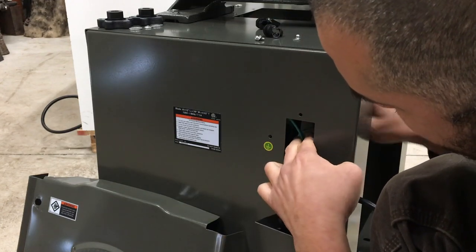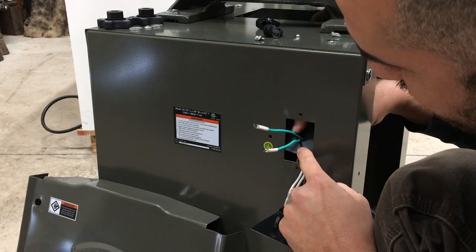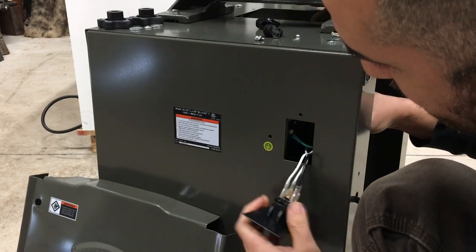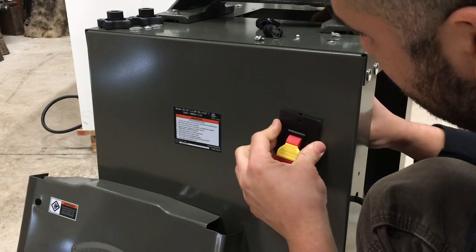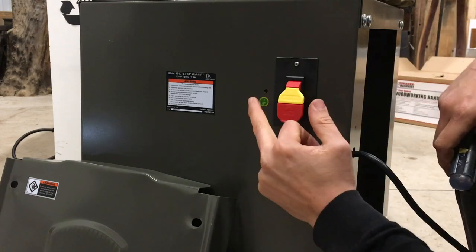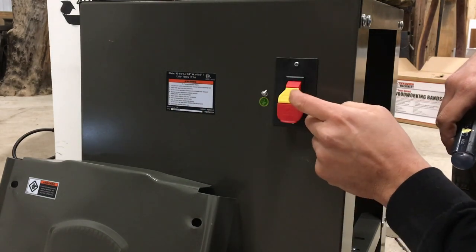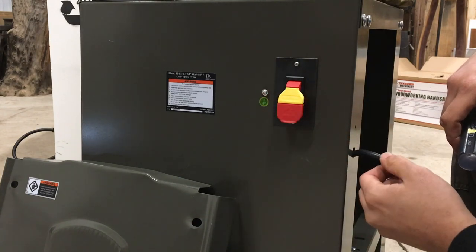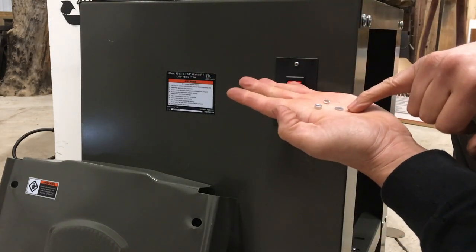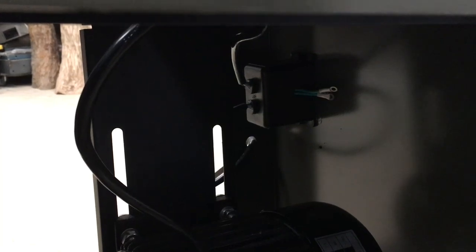Be sure that the two green wires from both the power cable and the motor cable are coming out of that little plastic box on the inside of your housing so that they can be screwed to this hole for your grounding. Now that we've done that, we can push these inside our box. Very nice. Now we'll go on the inside and get those green grounding wires from the box, and the two wires, your motor wire and your power wire, crimped to this. Hopefully you hung on to your little lock washer, flat washer, and the nut. There you see them right there.